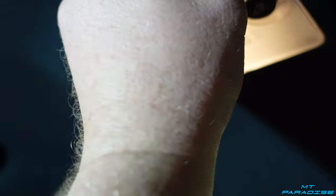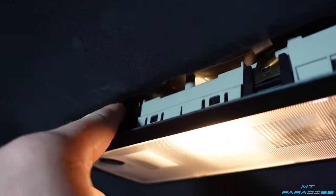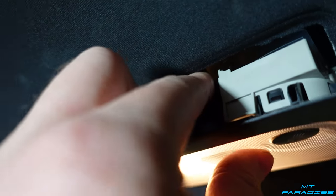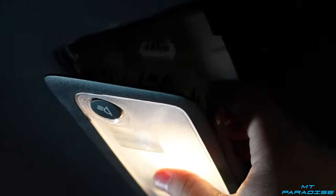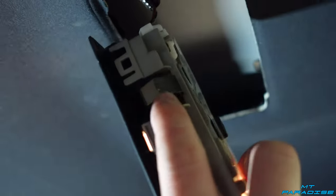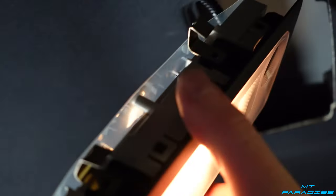Pop it down from the front edge, and once you get to that point there are little metal tabs in there holding it up — you can push those back. The metal tabs go up above under here, but on the back side I was able to get them to pop down. Just like that the whole thing lowers down. The ones on the front were kind of bent up and hooking onto the headliner, so just push those back down, then unplug it and move on.